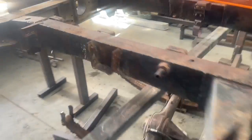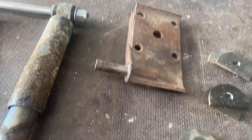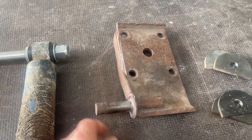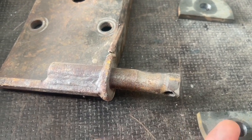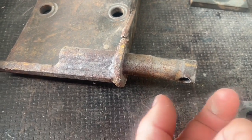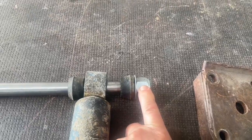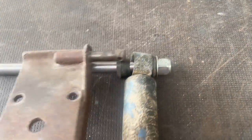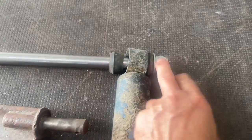The other thing we'll look at straight away is these mounts for the shock absorbers. As we all know, they wear quite badly here — here's a pretty good example — simply because the split pin doesn't pull the rubbers up tight enough, and you get all sorts of movement. What I'll do is replace that with a nylock nut and a washer, weld that in there, so instead of relying on a split pin and a washer, we'll have a nut that can screw the thing up tight. I know there are mods that have been done like that and people are happy with it.